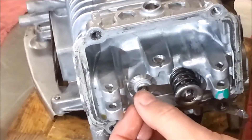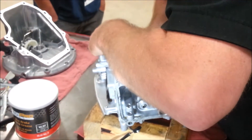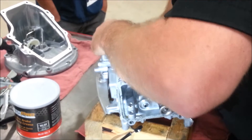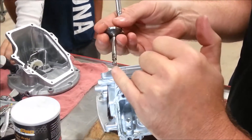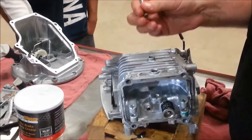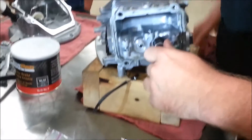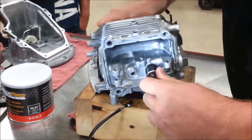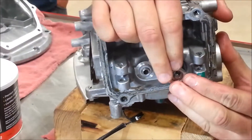The reason I wanted to grab my magnet here is just so I don't hit the cylinder wall. There might be a little burr on there from maybe the last person working on this. You can see how I was able to remove it without any damage. I'll just dump these in the bag quickly so there are no worries, then we'll switch to the exhaust side. Once again, rag in — it makes things a little bit easier.